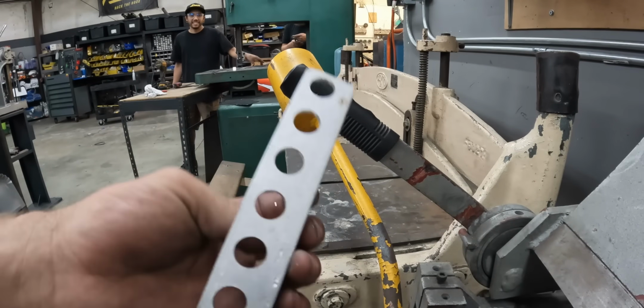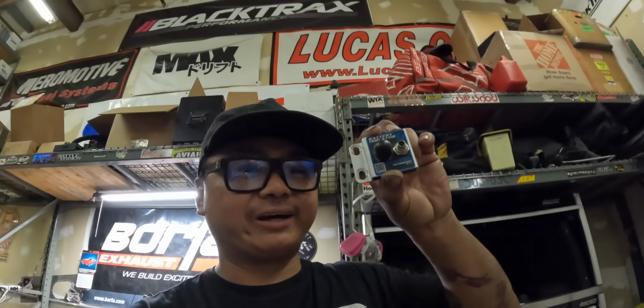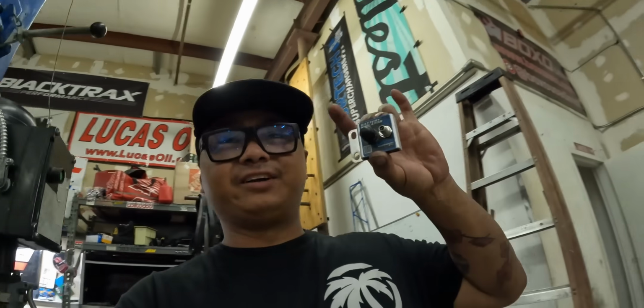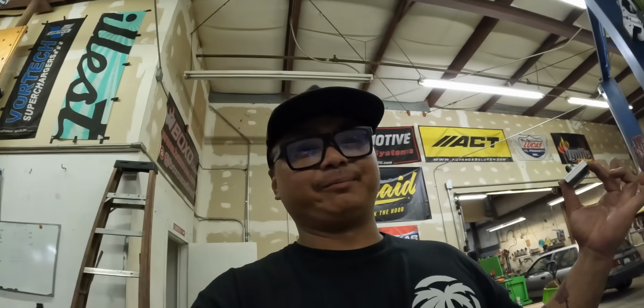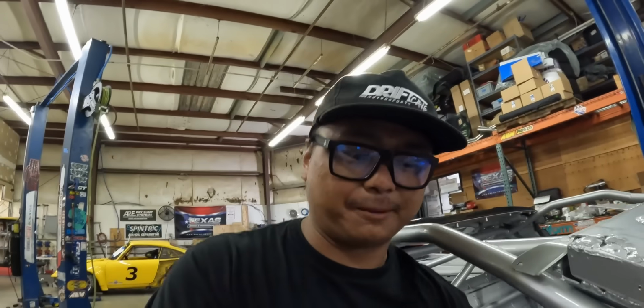All right, deburr. So while Matt works on a bracket for the battery mount, I'm going to go ahead and get this guy mounted up. This is a CarTech battery isolator, so it's essentially the kill switch for the car. There's a button that gets wired up to this thing, and when you press it, it lifts the ground, and then the power is disconnected from the car so that you don't have any draws and everything can shut down properly.